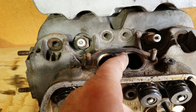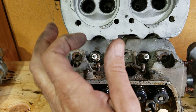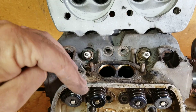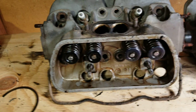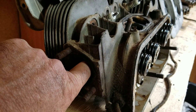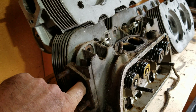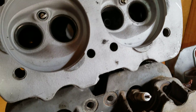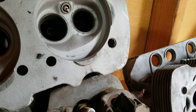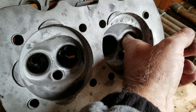What I did with these is I basically venturi ported them — the top of the port narrows down. These are stock valves, so the top is wider and then it narrows down, and what that does is increase the velocity of air going into your heads. On the outside I actually opened these up a bit, and there's typically a really strong right-hand turn right around the valve seat. If you take your valve out it's a whole lot easier to do, but you want to be careful not to take out too much of your seat support.